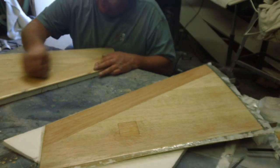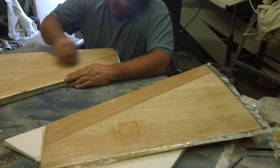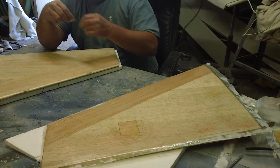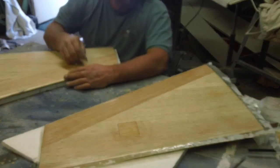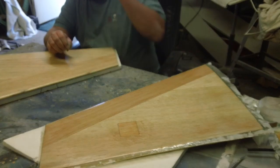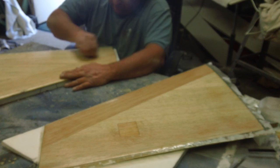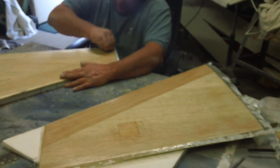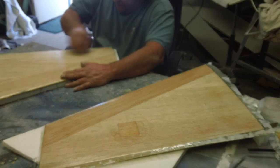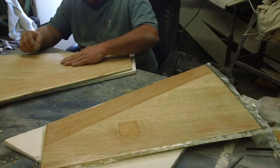One coat of primer, this is going to be looking good. No pinholes, zero. You always have to fight them pinholes, man. Come in here with that glazing putty and just putty this whole wing, and spend 2 days working on pinholes. Just pinholes. I started doing it like this, adding that second coat at the right time. Been spraying some primer on it, thought you got them all, and bam, there's some more pinholes.